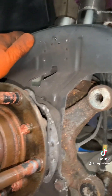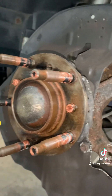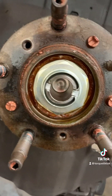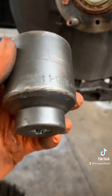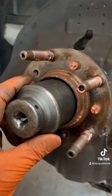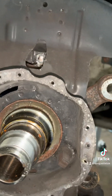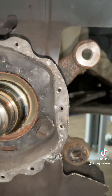To get the dust shield off correctly, I've got to take the wheel bearing off. Pop that out — it is a mahoosive socket. The front wheel bearing nut is massive; for some reason this is a 1-13/16th. I don't actually know what that translates to — very big is the answer. And then it's 3 x 10mm bolts for the heat shield. It's mainly held on by rust, so we're going to use a little lever, break all the rust out and get this out.